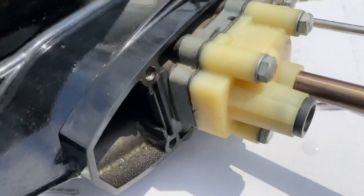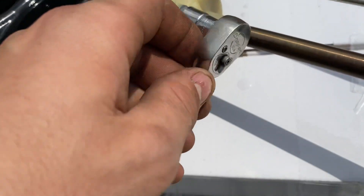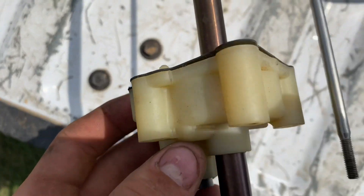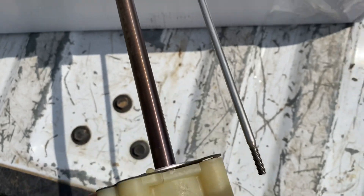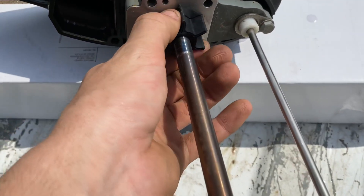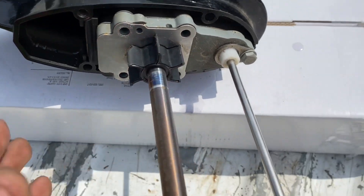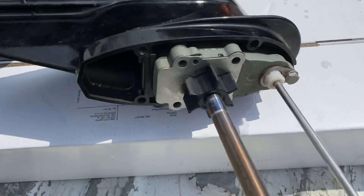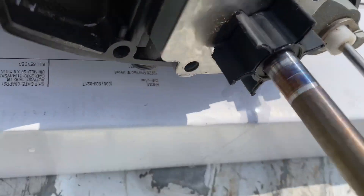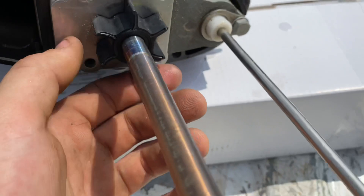Here's the impeller housing. You're going to have four bolts — it should be 10mm. Once those bolts are out, just go ahead and slide the impeller housing up. Be careful not to break it — it's just plastic. You can try to save your gaskets if you can help it. Then your impeller should just slide right off. I'm not going to take mine off — I just wanted to inspect it and see how it looked. Mine's a little dinged up there. I might order a new one for it.